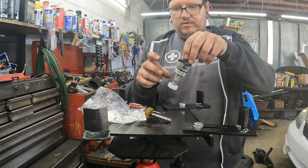Here's your drain plug. Toyota does not make fluid for this anymore, so we are using Valvoline — this right here is just Max Life. When you tighten this back up it torques to 25 newton meters, which is roughly 18 to 20 foot-pounds. Just don't over-tighten it. Looking at the specs, it says 3.2 quarts for a drain and refill with no pan removal.